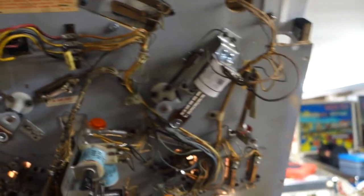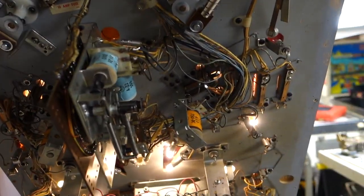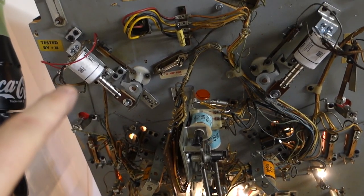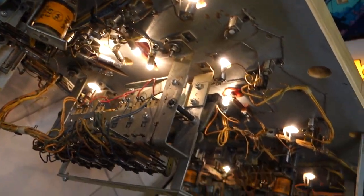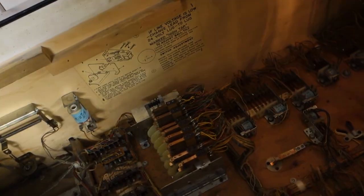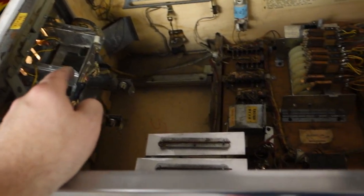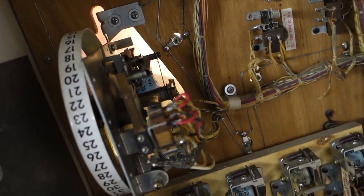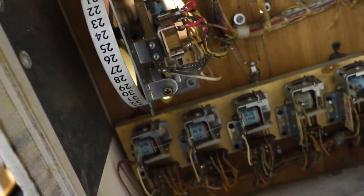The stepper's been all redone. Flippers were rebuilt when I got them, but I corrected the rebuild on them — they were all sloppy and loose. I put the washers back in them that are supposed to be in there. I readjusted the EOS switches so they're correct. There's no coin mech on there, but it is able to have a new coin mech and work again. I have my reversible mod — you can just cut these wires to turn off the free play. I like doing that instead of bending switches. This is all still fully functionable. So all you can do is cut these two wires and get a coin mech, and this will be back to coin play.